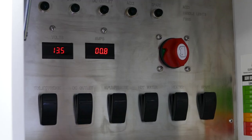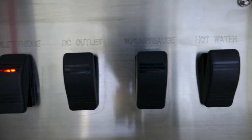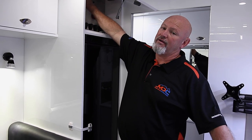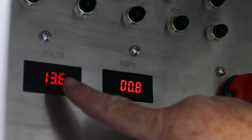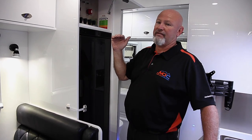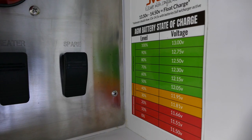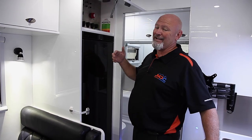Above your fridge, the little cabin up here is where your electrics are — your kill switch. So obviously you will turn that on, and you'll turn individual bits and pieces on. If they're not working, you've got resettable fuses up the top here — you just hit that twice, resets it. And if it doesn't work, basically you've got a little fuse behind there that you can replace if you really need to. You've got your voltmeter here and your amp. With your voltmeter, 13 is full. Do not let any of the volts go down past 12.2. I will tell you, once a month come out and check it. At 12.2 you've got to put charge in it. You get down to a point where you're at 40%, your batteries could collapse. So just make sure you maintain your battery system.